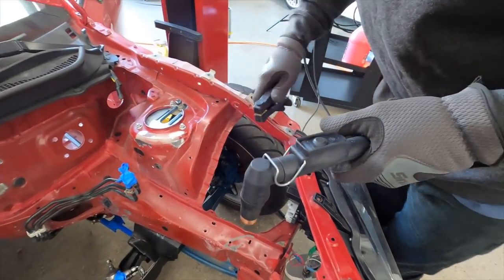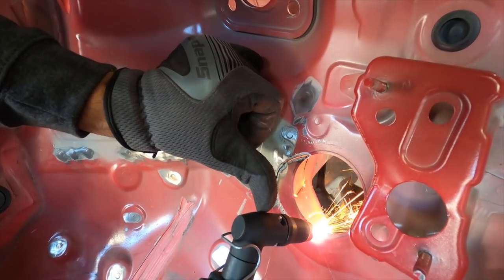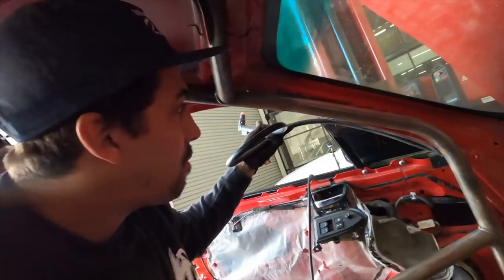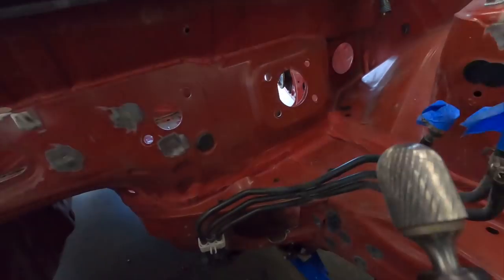All right, we're going to mount the steering column and we just need to make the hole a little bigger — right there — and trim a little bit outside of that. We just got the plasma cutter hooked up, so we might as well give it a go. That's a lot cleaner than I thought it was going to cut — I mean, it's not super smooth, but it's not bad. That was my first time seeing a plasma cutter do something in person. It definitely saves time, but it melts the metal so it doesn't leave a super clean cut, so we're just going to go over it and clean it up.